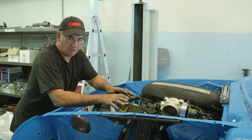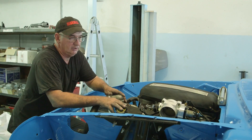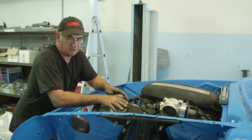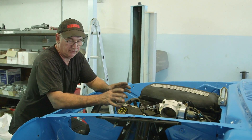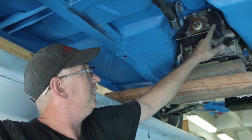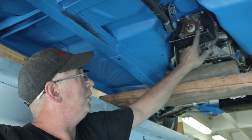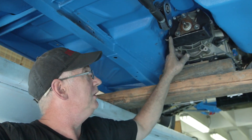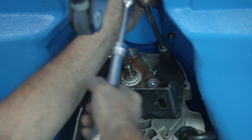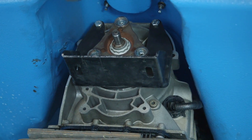There are optimum angles for this. For a Ford, we get the motor set ideally at three degrees to the center line of the car. On this particular build, we've incorporated a rear gearbox mount into the three-link front cross member. We've removed the original gearbox extension housing that had the mount incorporated in it and replaced it with one we make at RRS, designed to bolt simply into just about any Ford chassis. It's part of our transmission conversion swaps and an option with our three-link.